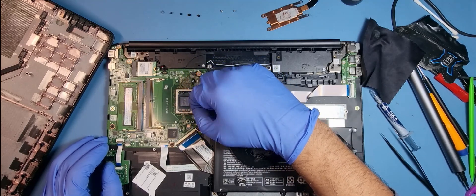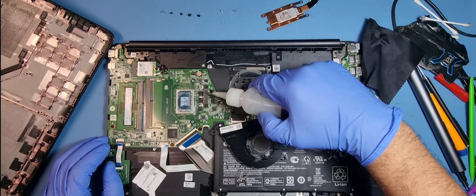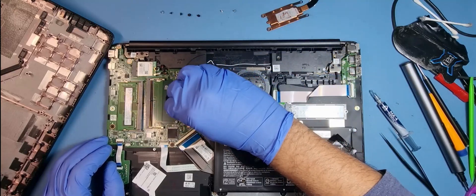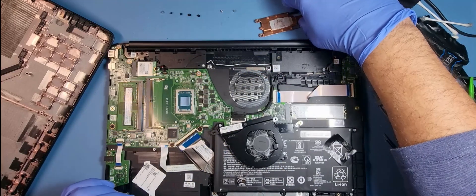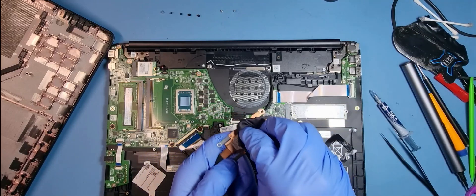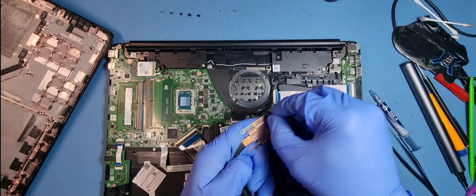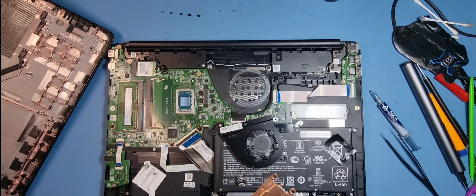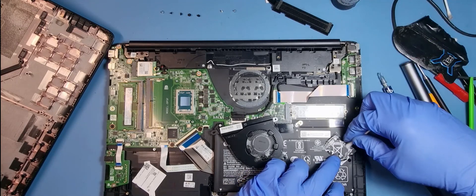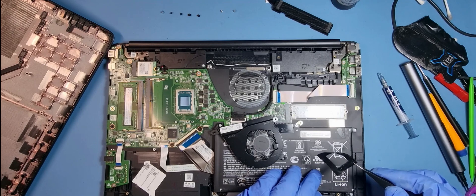This video kind of shows you how to replace a fan as well, so it's a two-in-one video for my viewers and my channel. I'm going to remove the paste off the heatsink as well — just clean that off with a bit of cloth. I don't want to get anything in the machine so I'll do it to one side. That's fine. I'll just clean off a little bit of the protection tape they had on there, and we can put that back on.